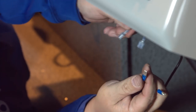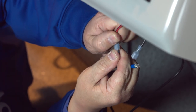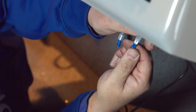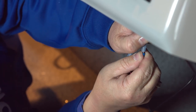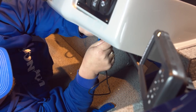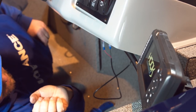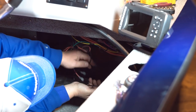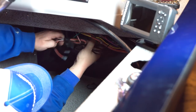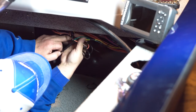Underneath this boat it already has spade connectors, so we're going to put the red into the red and the black into the black. Now that we've got red connected to red and black to black, we're going to go ahead and turn on our accessory switch and make sure we have power to the unit. Now that we have all of that connected and it's working, we're going to come in under here, take our excess wire, put it all together, and zip tie everything up nice and neat.